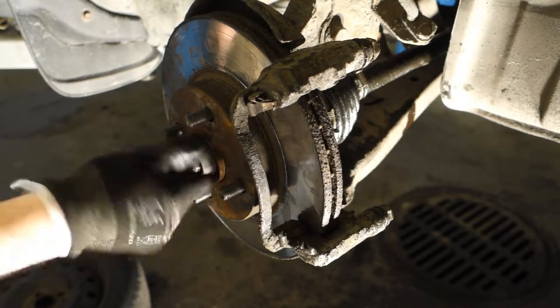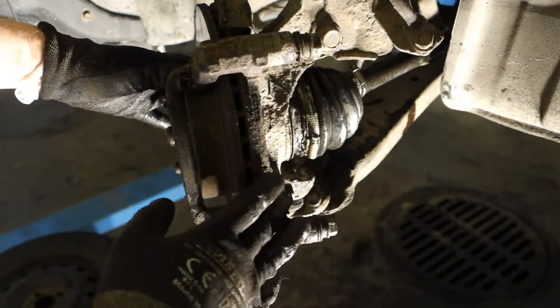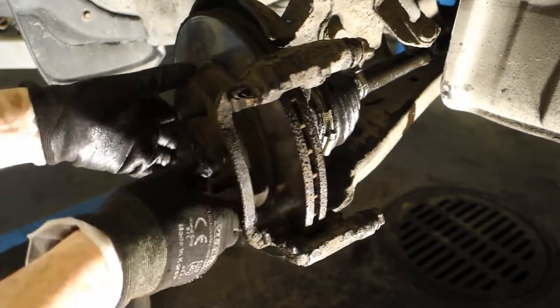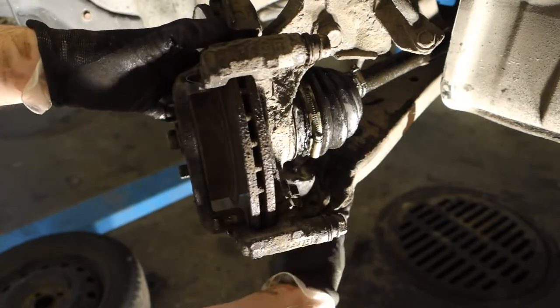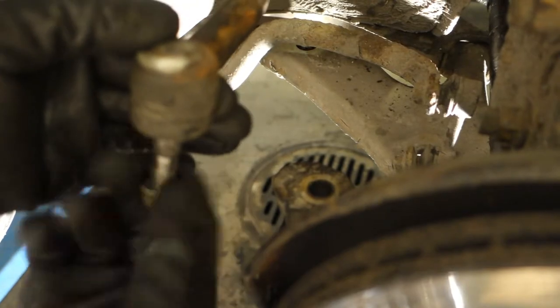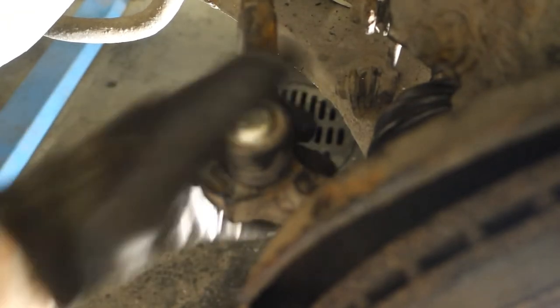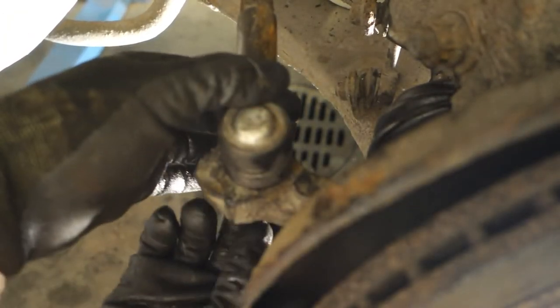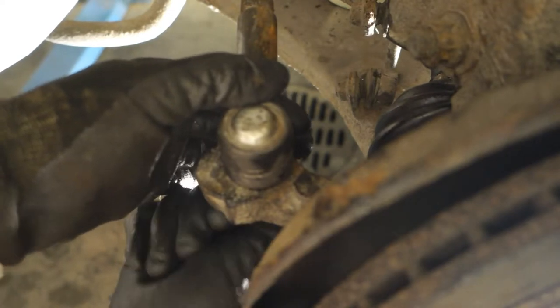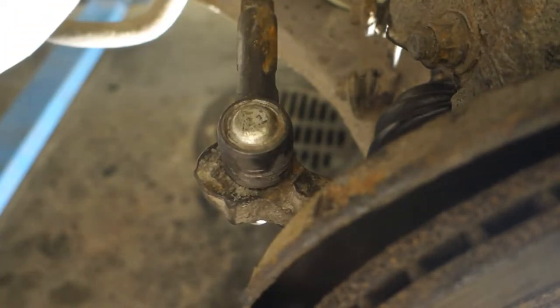Okay, good. And now I fasten this quite well. And then we had this. I need to insert back next these ball joint bolts, and then there is this tie rod end, and I insert that also back now. This in here, and I open that bolt, and now when I insert these bolts in here, this is only the start. I only insert this bolt, and the next step is to fasten and tighten these bolts with the right torque wrench amount, and it's really important. Okay, and this is fine.